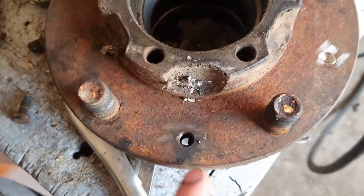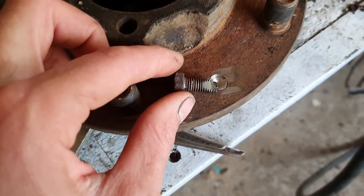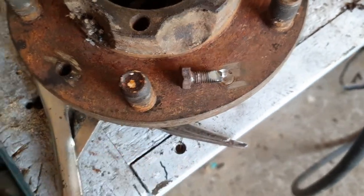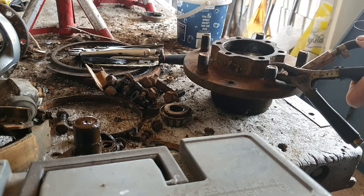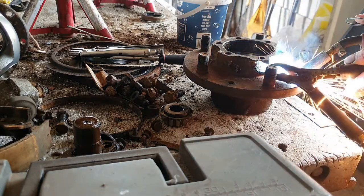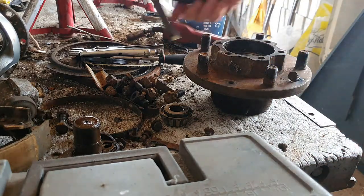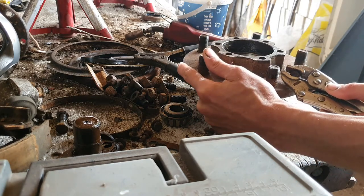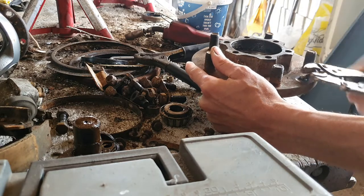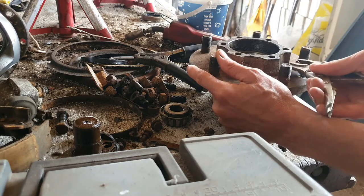So this is what it looks like once it's been drilled out. The drum came off but I've still got to extract it. You can see this one's got some blast marks from the welder and some angle grinding marks as well. I'll show you how I did that. I just got hold of a crappy little nut and I weld that onto what's left of the screw in the hub, and out it comes. It's definitely stronger but I think I've welded to the hub as well this time. The weld that attached to the hub has broken free and the weld that grabbed what was left of the screw has stuck — so it's coming out!